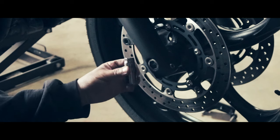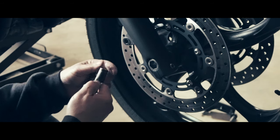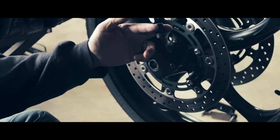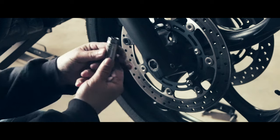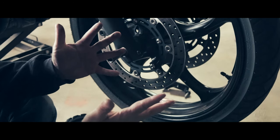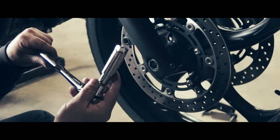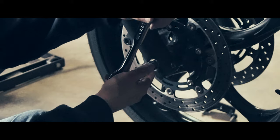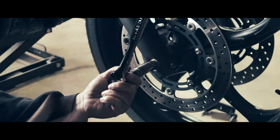Here's a quick pro tip from the forums: take your spark plug socket from your home socket set and remove the gasket from the inside — the part that sits on top of the spark plug as you're unscrewing it. The bottom of that socket is conveniently 19 millimeters. Put your extension through the big part, it locks in, and now you can loosen the axle nut. Don't forget — lefty loosey, righty tighty. You may need a cheater pipe or breaker bar.